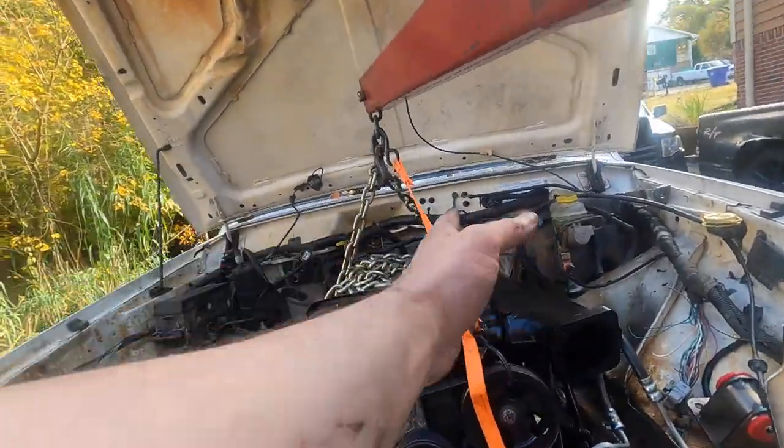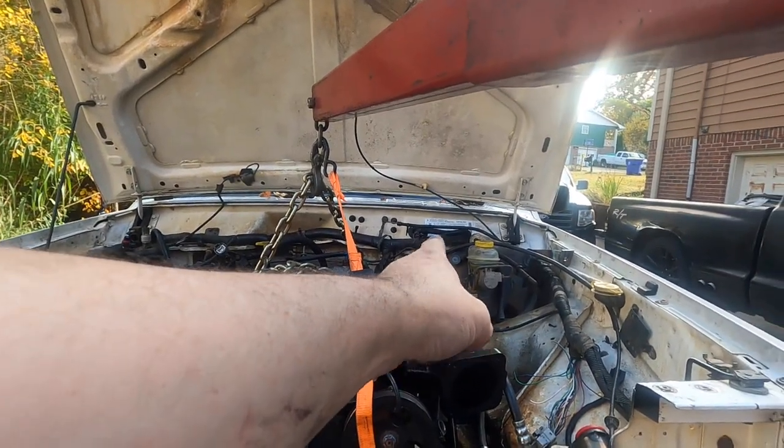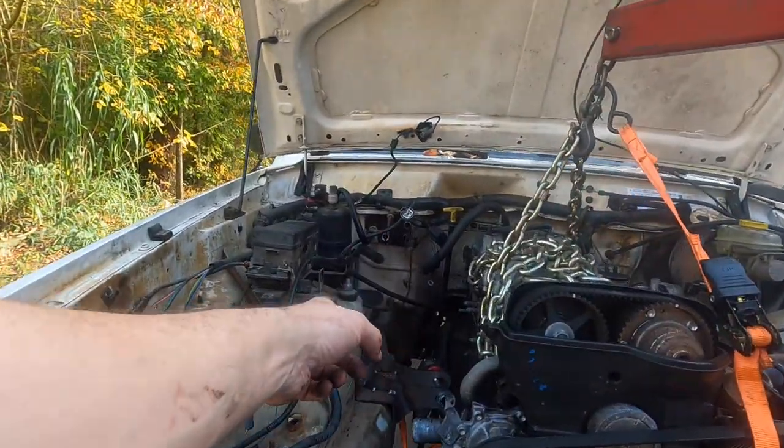It fits even better because with the GE manifold, we had to scoot the engine over to the manual holes, which is about 3/4 of an inch, because it hit the brake booster. With that manifold, and it coming forward, we were able to scoot it over that 3/4. So now we have more room for our turbo and manifold, which means the downpipe has more room, lots of stuff has more room.